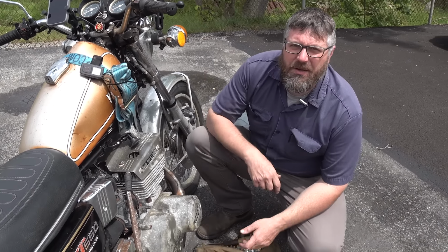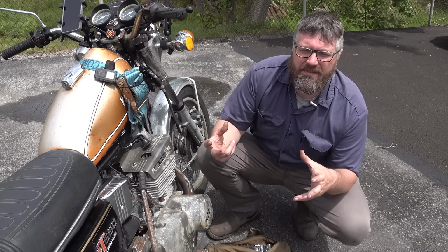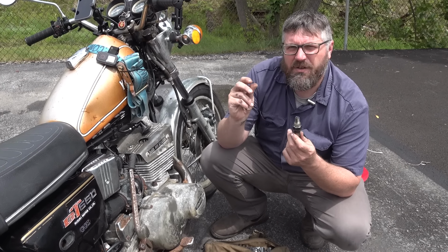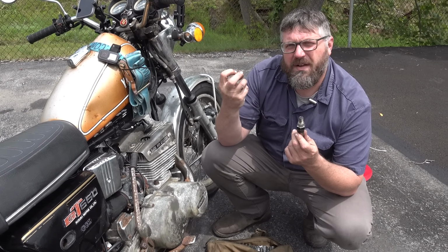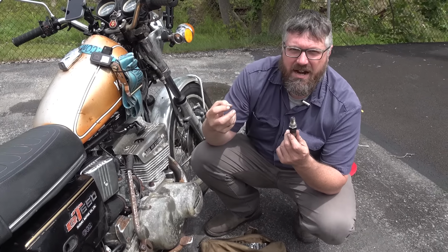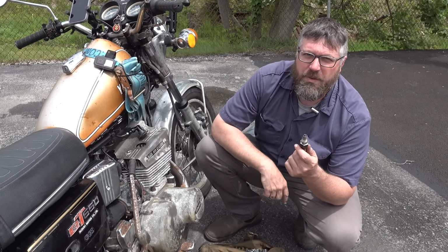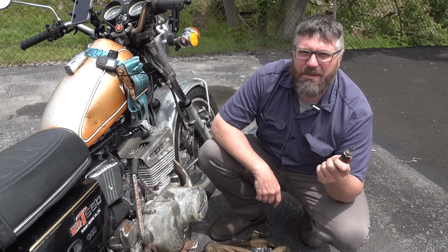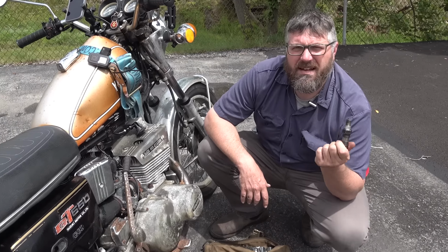All right, so here's the deal. We got a hole in the top of the piston, and that was probably caused when I was heading up that one big uphill. Once the plug starts nibbling away at the top of the piston and creating little imperfections, those little imperfections are thinner and just get hotter and hotter and hotter. Made a hot spot, blew a hole through the piston. Unfortunately, now we had molten aluminum going down into the motor. We are dead in the water right now, guys.